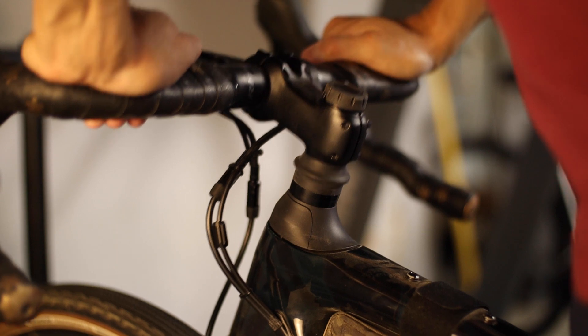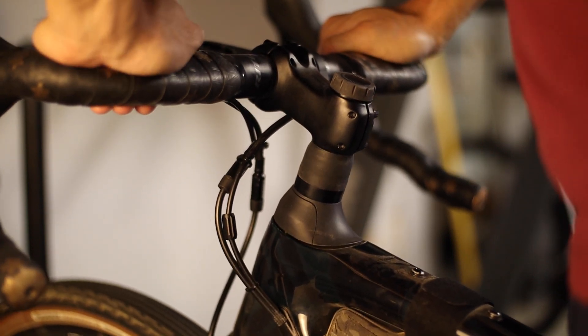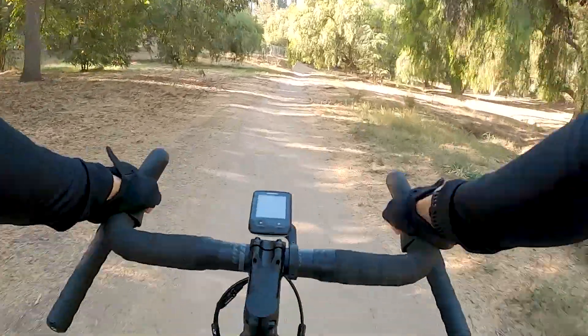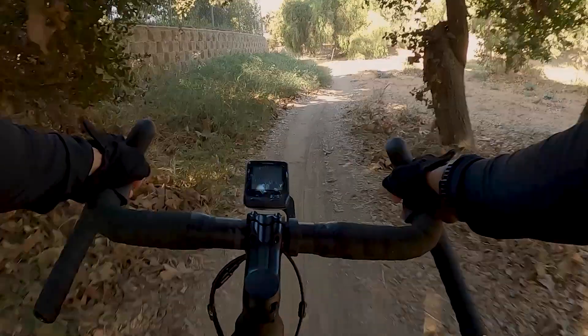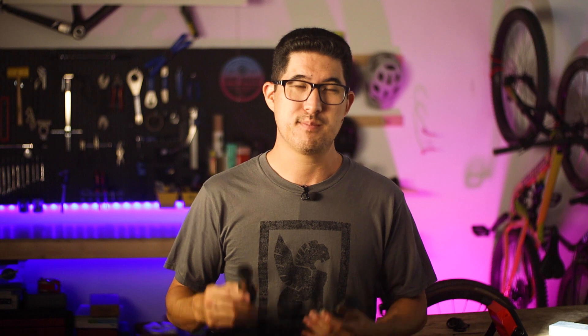I will say, however, if you are someone who appreciates the squish up in the front end but is also really sensitive to the motion in the bars during hard efforts on smooth roads, then it may be worth a closer look. However, I would not upgrade to the 2.0 hoping for a system that offers precise and incremental jumps in the system's damping. It's essentially a binary system — either fully open or fully closed with maybe a little bit of functional adjustability in the middle of the range. For me, the adjustment knob was not an absolute game changer. The axial compliance offered by the 1.5 is actually really nice, and when I switch to a bike with a rigid front end, I actually do miss it. When riding the 2.0, I find that I want to think that locking it out on smooth roads is going to make me more efficient, but I can't really confirm that it actually does.